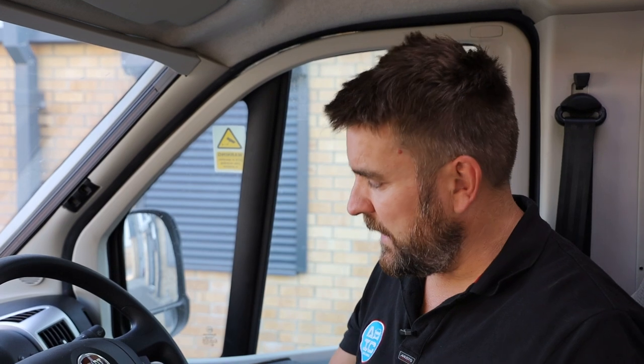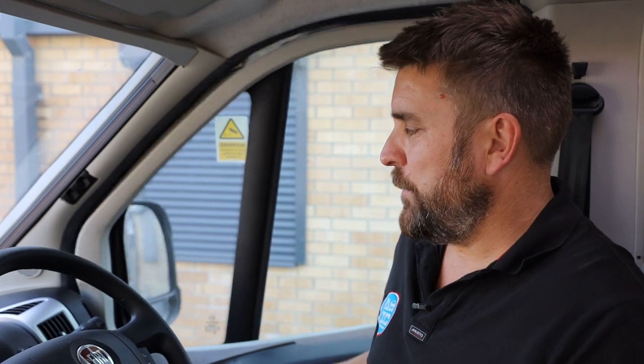Even if I had stolen the keys — I'm going to put the key in and try to start — all we're getting is just a click, because the immobiliser is basically protecting two circuits in the vehicle. Those circuits vary, but generally they are things like the starter, ignition coil, fuel pump — there are so many to list, but it all depends on the vehicle. When I then open and shut the driver's door, I can then turn off the immobiliser and do that. I can now put the key in the ignition and the engine starts.